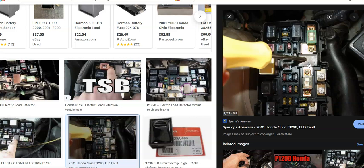You can go ahead and replace it — many people do that. But it could also be a blown fuse, either in the engine compartment fuse box or quite often inside the cab as well. There might be a fuse inside the cab controlling the circuit the ELD is on. Also keep in mind that wiring — any of the harnesses running into the fuse box or out to other components — could also be the problem.